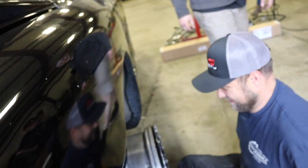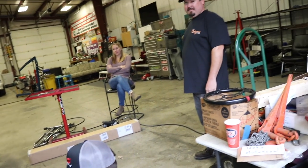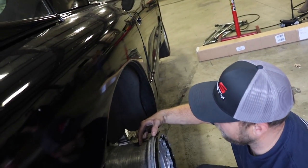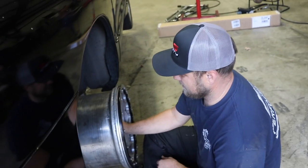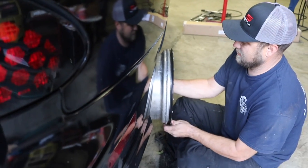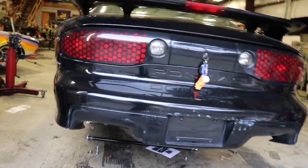With a 12-wide and 5.5 backspace it's going to sit differently. For a 10-wide I'd need 7.5 backspace — like a standard F-body — but then it'd be all the way in. You don't want 12-wide. This is some redneck fitment right here. I'll be honest with you, it doesn't stick out any further than mine.